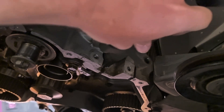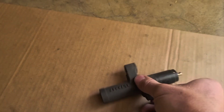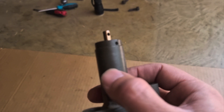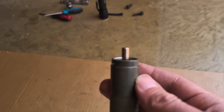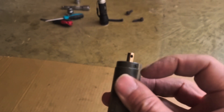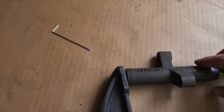If you're under your 3.5 Chrysler and you see this and wonder what it is, it's the tensioner for your timing belt — don't play around with it. To reset it, it's quite simple. You'll see it's got a little hole in the pin and a little hole in the body, and at the back it's also got a hole. You just want to push this pin back so you can put a pin through both holes to lock it in.